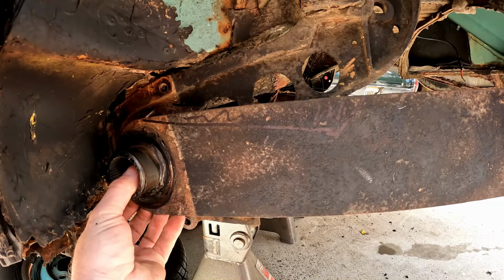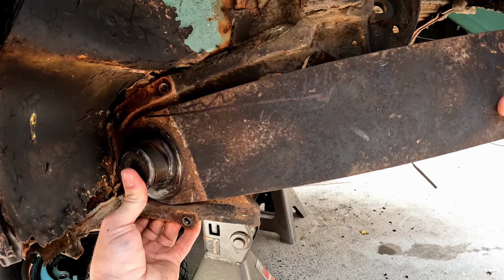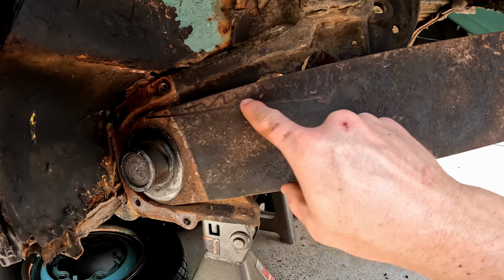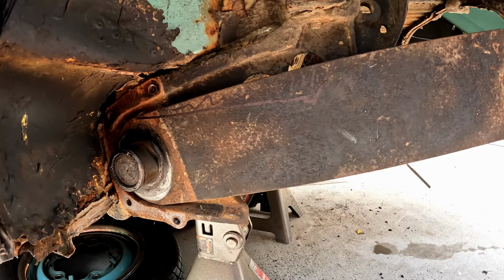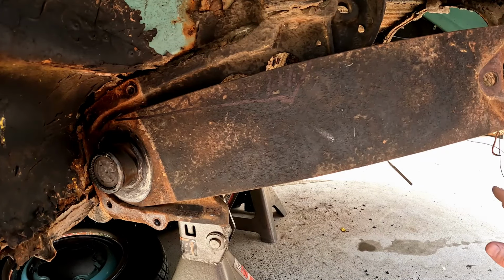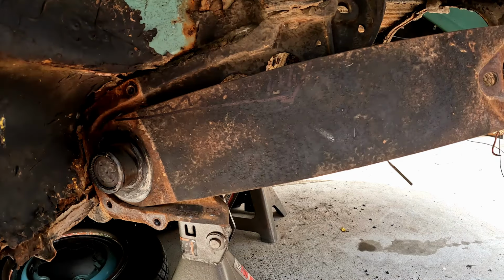So then, just for giggles, we're going to set this up one more spline to three splines. And you can see that is just absurd right there. And we would have to notch this significantly. Now, I've driven cars lowered three splines. And when you get to this point, this is where you're ruining axles, you're ruining the fulcrum plates in your spider gears. Like, this does a lot of damage. So without doing a transmission raise, you can't realistically drive around at this height. If you're trying to be this low, get some air ride.